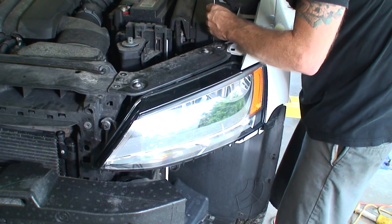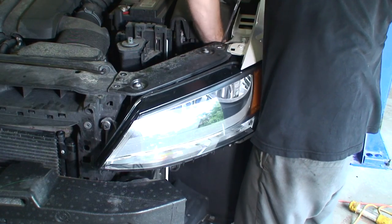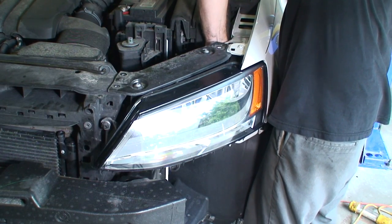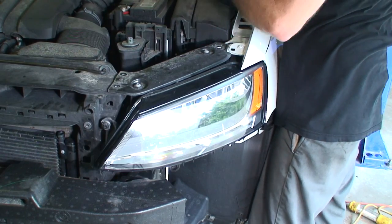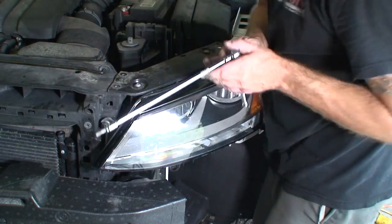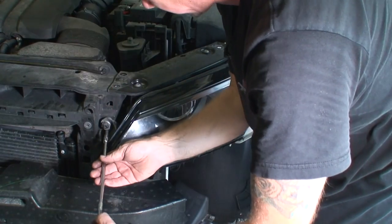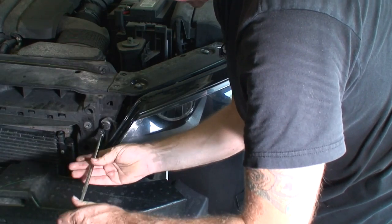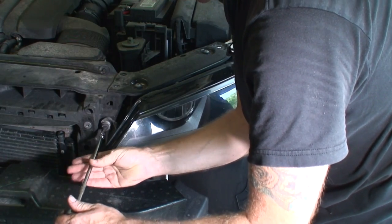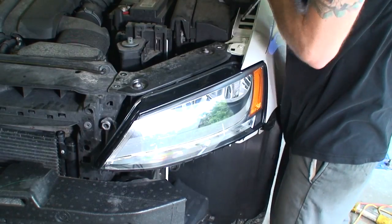Okay, so the adjusters are going to have some inserts that have nuts on them. Those nuts have a threaded side to the back, so that adjusts the height, the angles of everything. So as long as we don't move that insert and just remove the bolt, the headlights will go in with the same projection they have now.